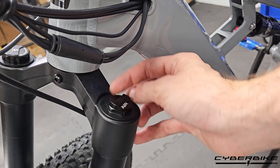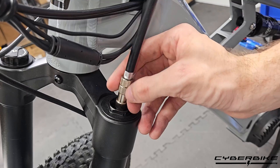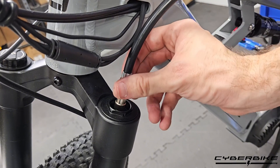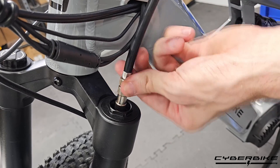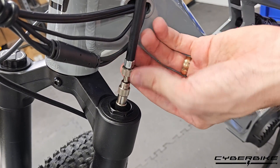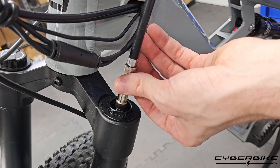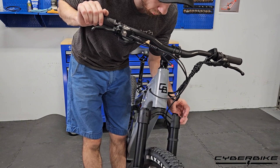Here on the air side, just like with the rear suspension, we're going to only use a shock pump to pump this up. We are going to go ahead and put on our pump. Remembering that a little bit of air may leak out, but that's okay. Then we will pump it up to our desired pressure. Once we are at our desired pressure, just like with the rear, we are going to undo this top collar here, slowly releasing the plunger built into the valve. Once it's all the way out, we can go ahead and remove our main valve. A little bit of air leaks out of the tube, not of the fork. And now we are set to the correct pressure and we're ready to ride. After we have it all aired up, go ahead and put our little cap on there securely.